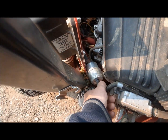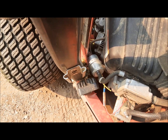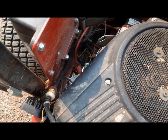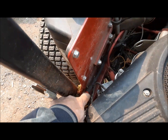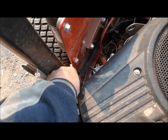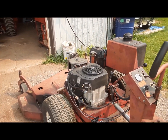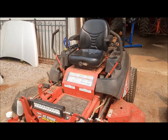This one has a tin filter from a car on it — probably a used one I put on it. We'll get that off and put a new one on. The filter on this one was definitely plugged — when I took it off, there was no fuel running out of the supply end; all the fuel drained back out of the feed end. I just had it out for a few minutes mowing and it was fine — no trouble. Maybe we fixed it. Now I'm going to get the second one out and try it.